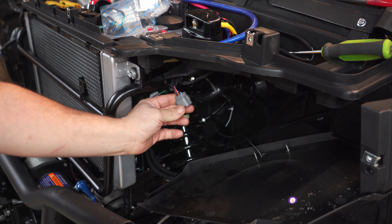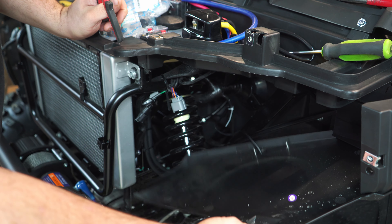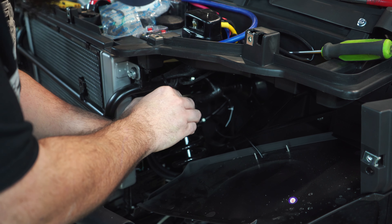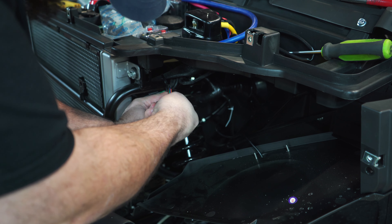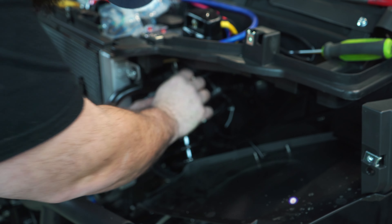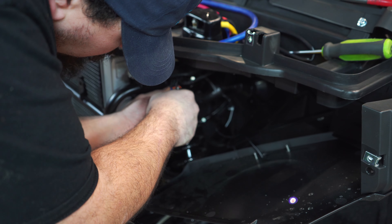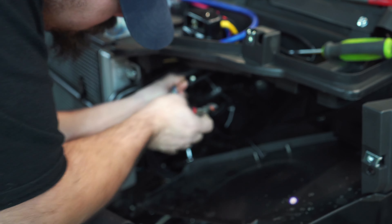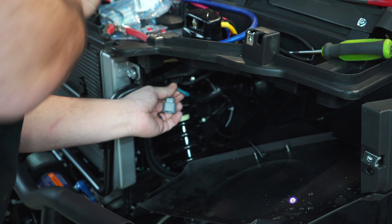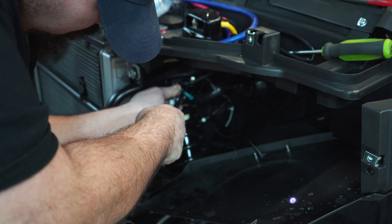On the driver's side, the plug goes into the headlight. You don't have to take all this apart to get to it, but you do have to pull these two clips out, pull this down, and unplug it. It's going to be the orange wire — driver's side. Clip that, and now we're going to put one of these heat shrink butt connectors on it. Strip that wire using wire strippers. The heat shrink butt connector will seal that wire from any corrosion or water moisture.